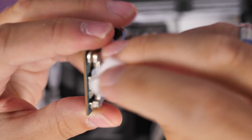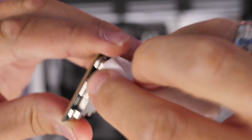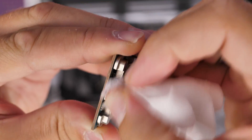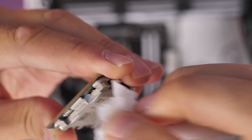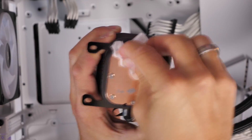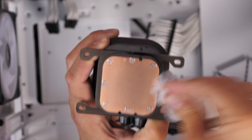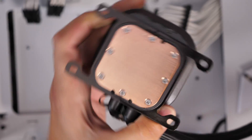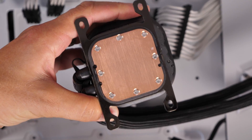They're really easy to use. Unless you've got something a little tricky like a Ryzen CPU with notched edges, it's pretty easy to just wipe it clean. You can clean up both the CPU and your CPU cooler — the pump block here, for example. You'll see just how easy it cuts through, and it will work even if the thermal paste has been on there a while. You might want to do this to upgrade the thermal paste — just rejuvenating it can really help.